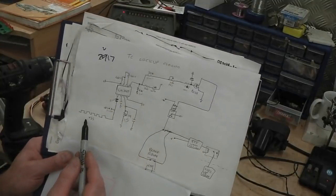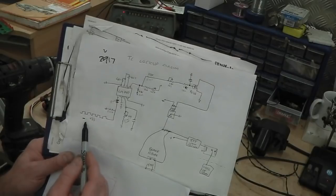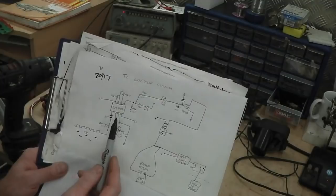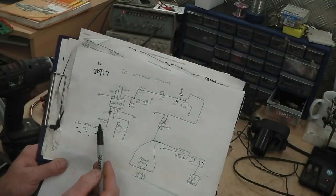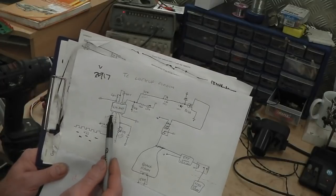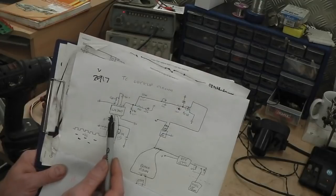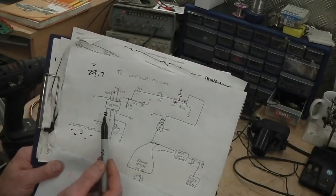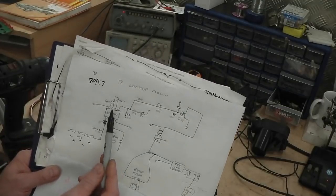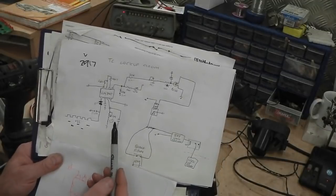There it is. There's the speed sensor square wave input. That's just what you saw on the scope screen, although you saw it more like this shape, but it's the same thing. That's coming into it. It goes through a little capacitor to isolate it out. So this is never directly connected to the sensor. It's gone through a little filter, what's called a capacitor, and it can't physically connect. That makes a buffer zone. It's a little safety feature. And we've got various adjustments here to control that switch point I talked about.